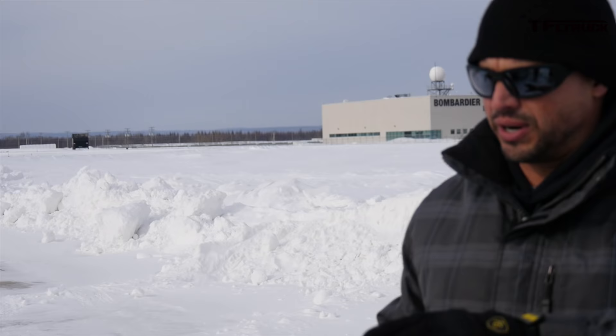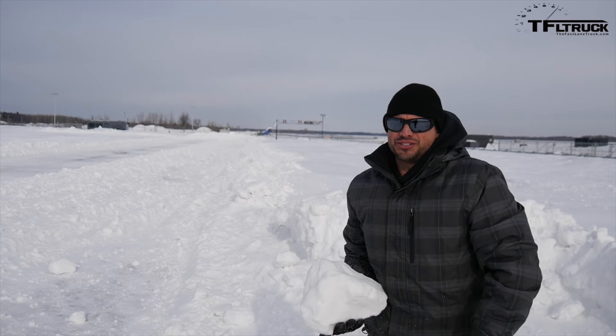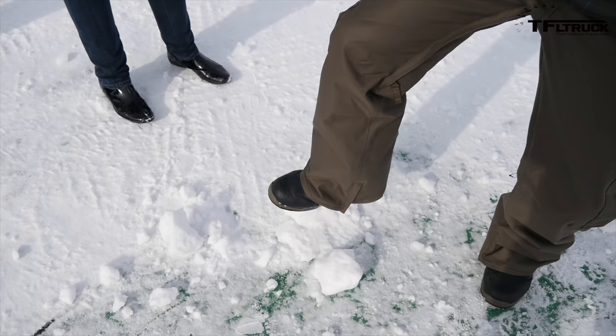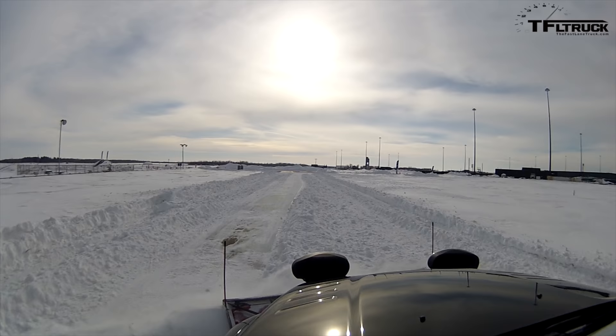We put 500 pounds in the bed over the rear axle to compensate, because you have 700 to 1,000 pounds sitting on the front and hanging off — which has an exponential leverage factor. Not all snow is the same: some is nice and fluffy, but this is more like a rock. When you're moving material, you need to understand the type. Lighter, fluffier snow lets you take a bigger bite. In negative 20 to negative 30 degree conditions, snow rocks up and turns into more like crisp cookies — more like rocks than the light fluffy stuff.